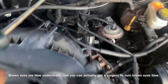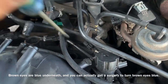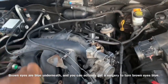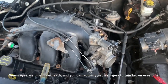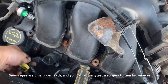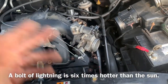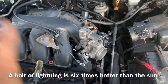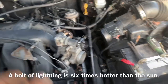Once the screwdriver drops down in there well, that means your valves should be closed. The other alternative — which I don't prefer — is to remove the valve cover and make sure you're off the lobes, but that gets complicated. This screwdriver method is the simplest way. And don't worry about the engine starting on you, especially with the coils all unplugged or the intake removed — it shouldn't run.